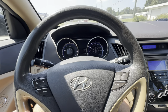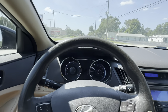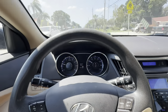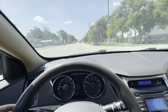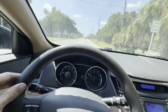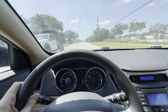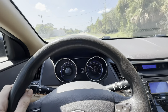It seems to feel a little unstable too. If I turn left, it stays going left. If I turn right, it stays going right - on top of that wobbly steering column condition. So there might be a couple things going on here because it shouldn't be sticking with its steering. Yeah, that's not okay. Maybe a sticking ball joint or a strut plate or something like that going on down below, and then there's some wear going on in the steering column.